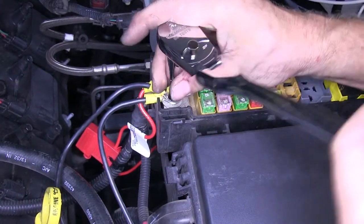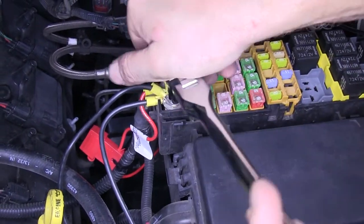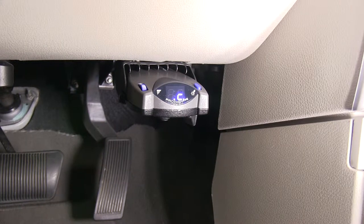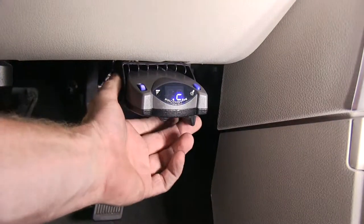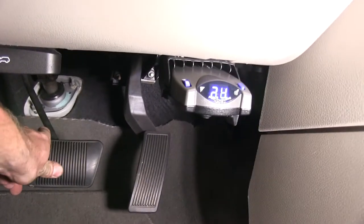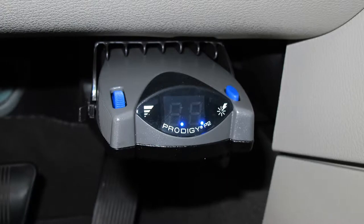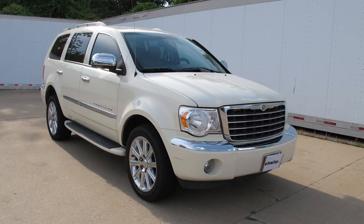One of our last steps is to go back underneath the hood and take the two black wires and connect them up to our power supply. With our power hooked up, let's plug a trailer into it. When we plug in our trailer, we'll see a 'C' for connection. Next we'll try the manual override and you can see it goes through the numbers. Then we'll test our brake pedal — you can see it goes up to 2.1, which tells us we have signal coming to our brake controller. So we've verified that the brake controller works. That finishes the install of the Tekonsha Prodigy P2 brake controller, part number 90885, and ETBC7 kit on our 2008 Chrysler Aspen.